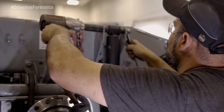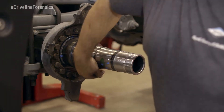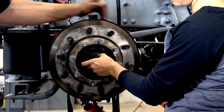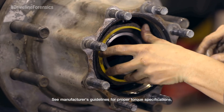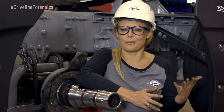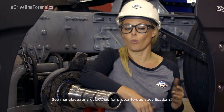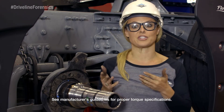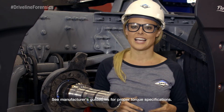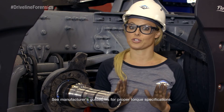While you're here, reinstall the shocks. Next, we're going to lube the spindle and hang those hubs back up by running the spindle nuts down while spinning the hub — that'll help properly seat the bearings. Depending on the style of the spindle nut, tightening sequences and torques vary, so make sure you see the manufacturer's specs. Now you're probably saying, Christy, you know what part you're installing, so why aren't you giving us the torque specs? Well, it's because even though we know I'm installing Spicer parts here, this video is probably going to be used for installation advice on other parts, and I would never want someone to misunderstand and torque to the wrong specs. There's just too much at stake if these bolts back out, so you've got to do your homework and read the manufacturer's guidelines.